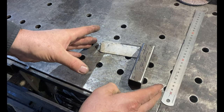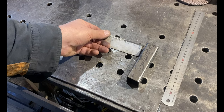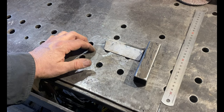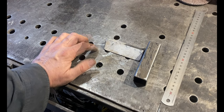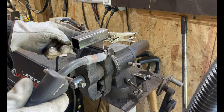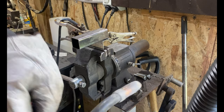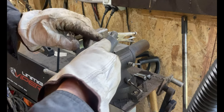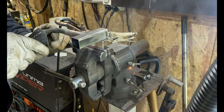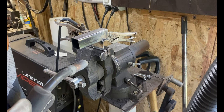That's how you need to build that little bracket to house that particular handbrake. Of course, if you wanted to modify it to be different, there's nothing stopping you from doing that — this is just the way the doctor has come up with it for my scenario. That's the beauty of the human brain; you do it how it works for you — just use this as a guide. Make sure you've got this squared — put a square on before you clamp it. Make sure it's square. Also make sure you've got some good ventilation happening. Now let's tack it in each corner, then we can weld in earnest.